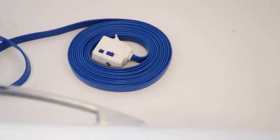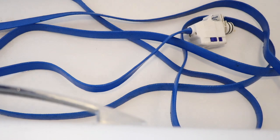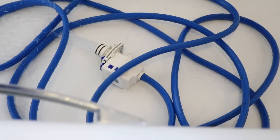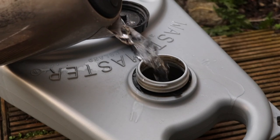One thing I didn't mention in that video is how I sterilize the fresh water hose for service pitches. It's far simpler than you might imagine — I take the hose home, coil it up in the bath, measure out a jug of warm water with some Puraclean, and pour that into the hose with one end blocked off. I leave it for a few hours, then empty it out and run through some fresh water. I then swing it around to remove as much water as possible before coiling it up and bringing it back. Alternatively, you can fill the bath with water and add sterilizing solution, though it's harder to measure the correct dosage that way.